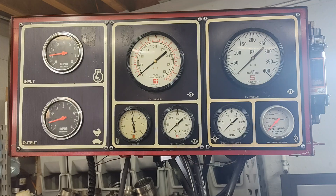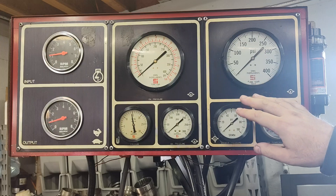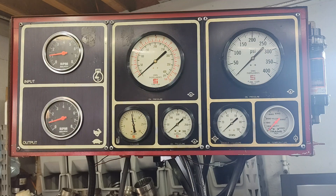That's about it — I just wanted to see that in action. If you ever see that pressure tap on your C6 and you're having high gear problems, feel free to put a pressure gauge in there and do this little check. Make sure you only have pressure in reverse and third — never pressure in any other gear, including park or neutral. This unit is working well, we've got good pressure and flow, and it's for a high power, big cubic inch application making a lot of power. I think that's all I've got to show you on that — that's how to use that port if you have it, and I encourage you to use it. These things can come in handy. Thanks for watching.